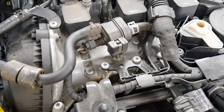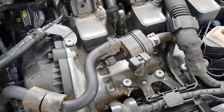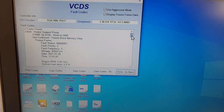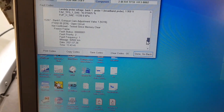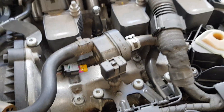So next what I'm going to do is disconnect these and see if I lose any of the shorts — is the component shorted or not? I'm going to go for these three first. I'll disconnect them and we'll see if we get open circuits, or whether we lose the other codes and narrow it down to a component. So I've been disconnect testing — that one's still short to ground, open circuit, open circuit, open circuit. It hasn't got rid of any of the short codes, but it does know they're open, so it's obviously monitoring something on all of these.